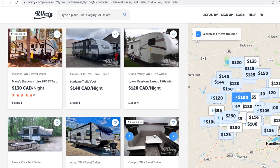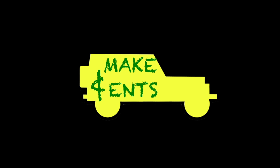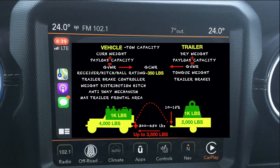Now for subscriber tips. This week's tip comes from last week's video on viewers' travel trailers. Subscriber Bill writes: 'I'd prefer not to tow at or even near max towing capacity of any vehicle. Apply the 80% rule if possible.' Great tip, Bill — that buffer comes in handy if you make a mistake in your calculations or encounter headwinds or steep grades along the way. If any of you have tips to share, put them in the comments as they may make it into a future episode.